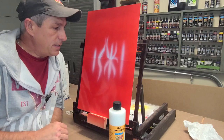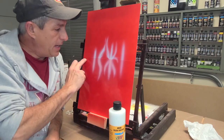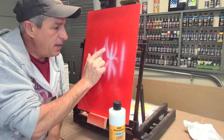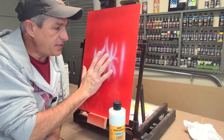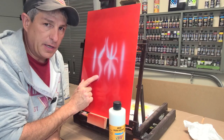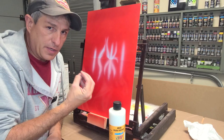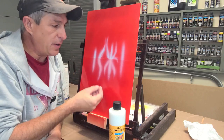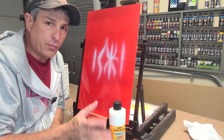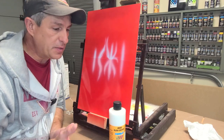All right, we're back. After laying down the white, I went in the house for a little while, came back out, and here's our tape line. You can see where we had the 4040 bleed checker, our white stayed nice and crisp and white, and down below where we didn't have the bleed checker, it all turned pink. So it bled through. That's what happens with a dye base or the candy: because it's a dye, it will bleed through your paint. So you have to seal it off with something, and the 4040 bleed checker is a really good option because a catalyzed clear is very expensive.